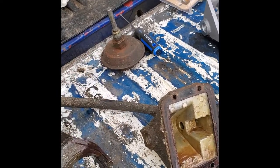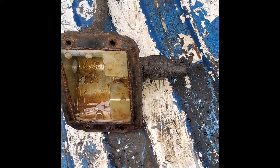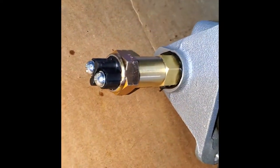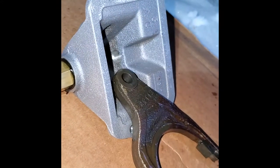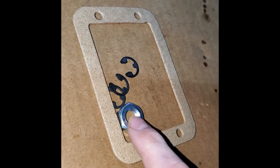I make sure the vent cap is free - I might clean it up a little bit, not much point because it's just going to get filthy on the road the first time anyway. I'm going to leave the sensor there for now. I got the sensor adapter and the light sensor itself threaded into the new CAD housing, and I put some thread sealing on there - it said to use RTV but I just used thread seal and thread locker just to keep the water out. The forks are ready to go on and I've got the three snap rings to go in the three grooves.